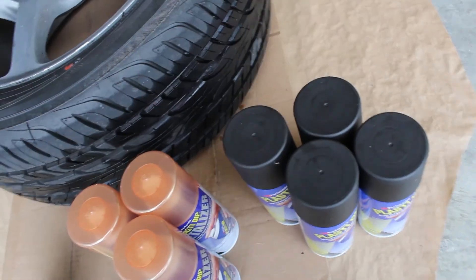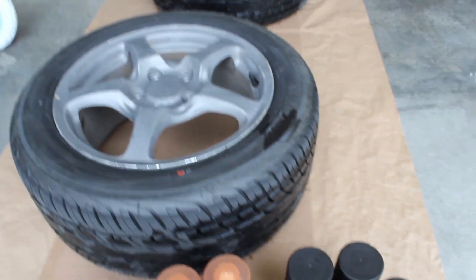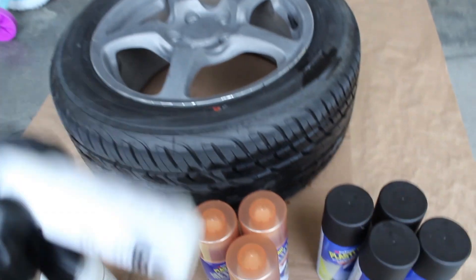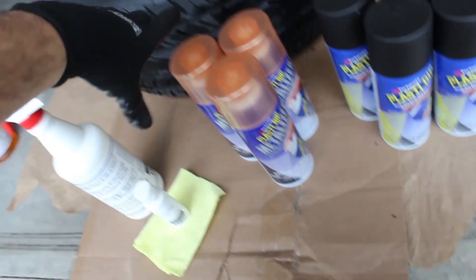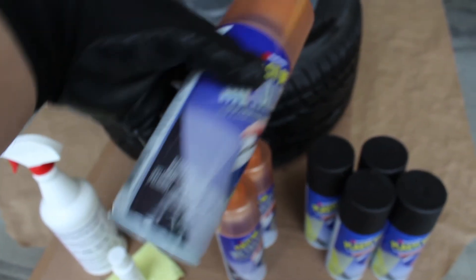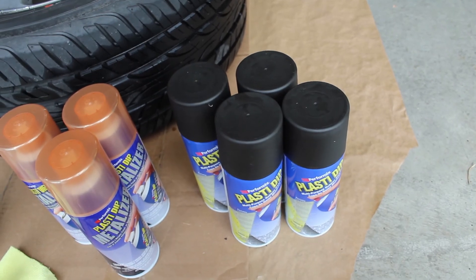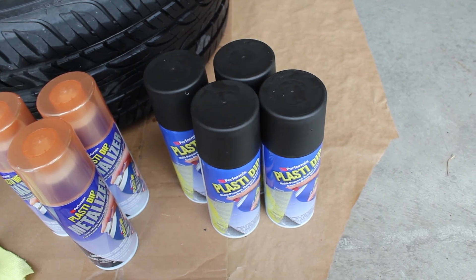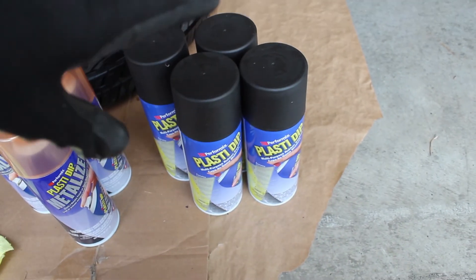Originally I was going to deflate the tire and put some blue tape around it, and I tried to do it that way. But I realized that the kit actually comes with the release agent stuff, so that's good. For the color I'm going to go with, I'm going to go for the copper - copper metal. This is the metalizer, the Plasti Dip metalizer. It's pretty neat stuff. As you can see over here, I've got four cans of just regular flat black Plasti Dip. This is what everybody used, you know, five years ago when it first came out. Everybody wanted to do their wheels, and it's amazing stuff.